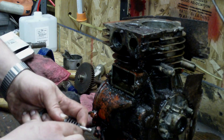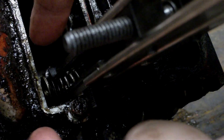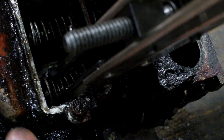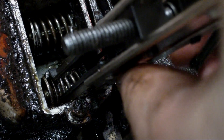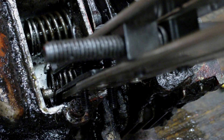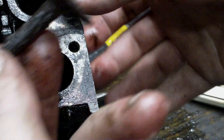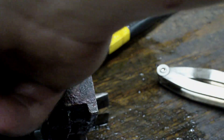After you get your valve spring compressor adjusted, these little screws — screw them in to make it tighter so the claws come in closer for small springs. If you're working on a big engine, back these off so it's spread out further. Then just tighten it up, keep some pressure on it, and you'll see it come loose. Now you can pull the valve out — take a flat screwdriver, press from the valve stem until it sticks out enough, and wiggle the valve out. There's the nasty intake valve. It needs cleaned up a lot, might need replaced. And here's the retainer clip that came out with it.